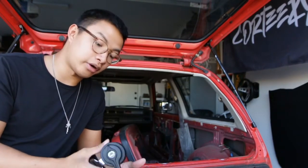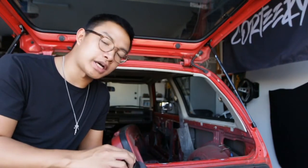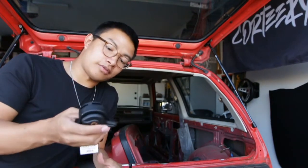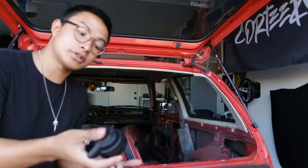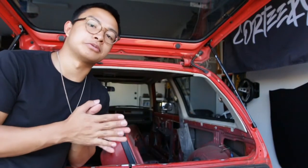We found no need for a five-point. I know there are a lot of articles about whether four-point harnesses are safe on the street — five-point is actually a bit safer because it prevents submarining. We're building this as a track car, and we're leaving the original three-point seat belt in so on the street you can use that. On the track, you'll be nice and snug in the new Recaro buckets — check out that unboxing video. These will hug you in place. First pair of harnesses I've ever owned, pretty cool.